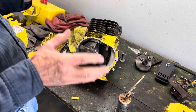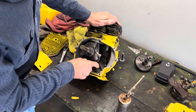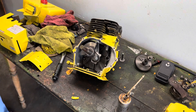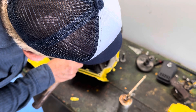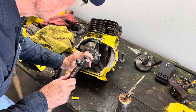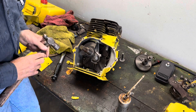So now what do you think we got to do next? We've got to bend over these little tabs to lock those mounting bolts in. Remember they were bent down? That locks it in place. So we're going to get ourselves a little hammer and pick up a little punch here. Then we're going to come over here — you see the little tab right there. We're going to hit that down. That one's locked in. We'll take this one and lock it in as well.